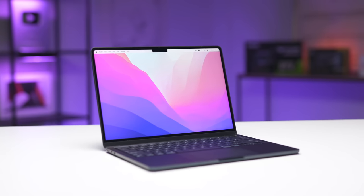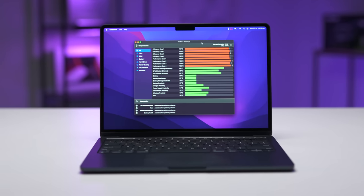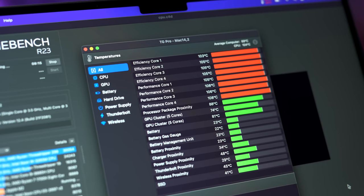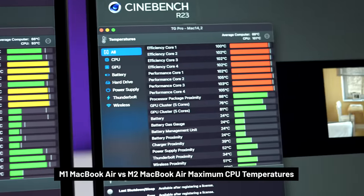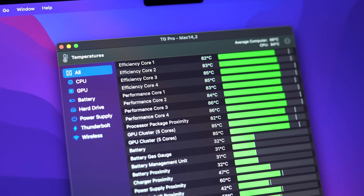Let's talk about just how hot the M2 MacBook Air gets. If you're just browsing the internet or watching a video, it won't even get warm. But once you start doing something more intensive, for the first couple of minutes the CPU cores would reach over 100 degrees Celsius — very hot and significantly hotter than the M1 MacBook Air. Apple is allowing the M2 CPU to reach much higher temperatures before throttling. After that initial burst of typically around three to five minutes, the temperature drops to a relatively cool 85 degrees, because the M2 chip reduces its wattage on purpose to lower the temperature.